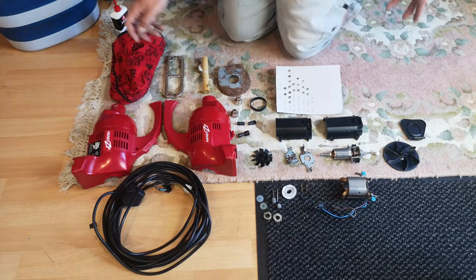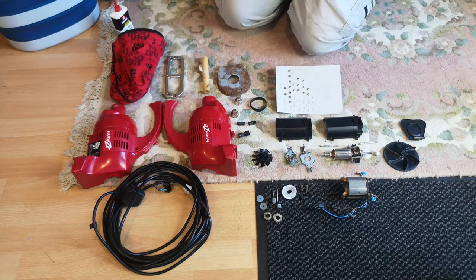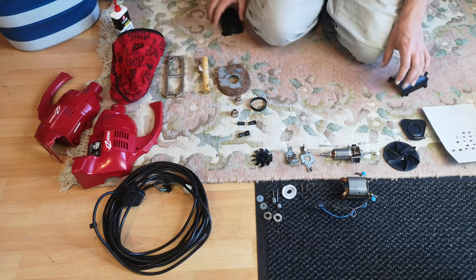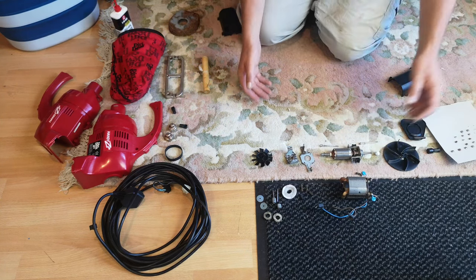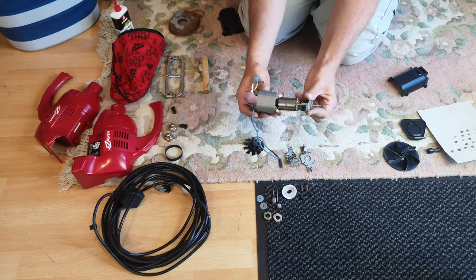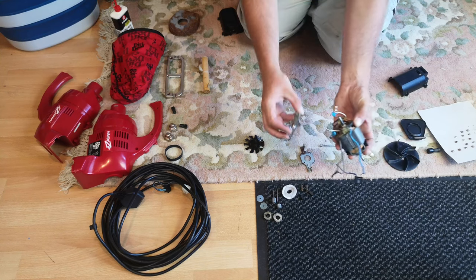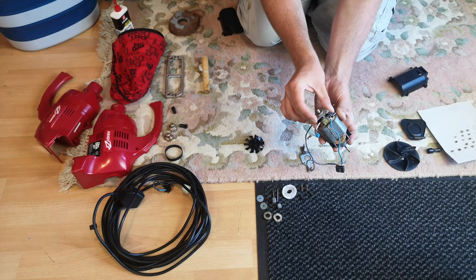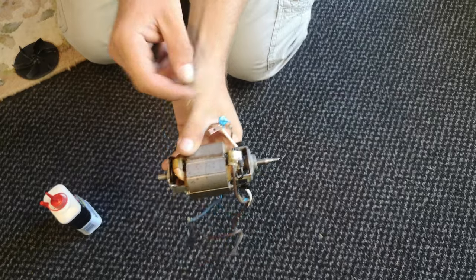A few days later in my world - we have clean, not shiny but clean, tidy, ready to reassemble. We won't need those bits straight away because we've got to start with the motor. That's the brush roll - we'll need that. That is the motor spinner. In theory this is roughly how it all needs to go together. We need to take our armature and pop it into place. We'll oil it from the top in a minute before we put everything else back on. I'll be very careful of the wires.